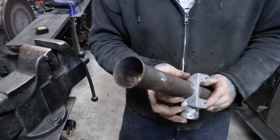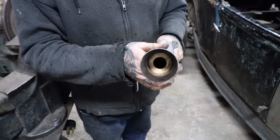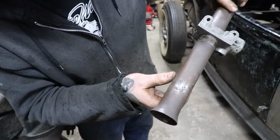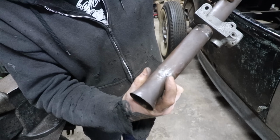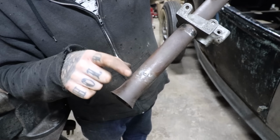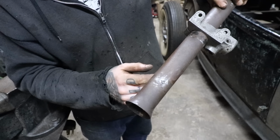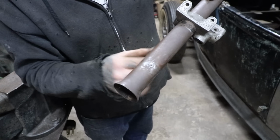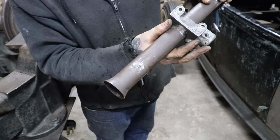All right, so I got our bushing installed here. As you can see, it sits a little deeper than the one we put in. And you can see I have these little set screws, trying to get it to focus here, that are set in just above the surface. They thread into that bushing and a little bit sticks out, and all that does is keep the bushing from sliding back and forth and floating around in there too much. So they're just a precautionary thing. It's tapped in there and good.